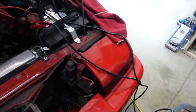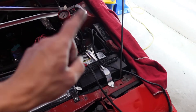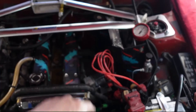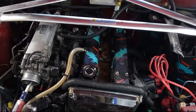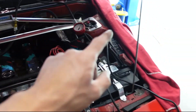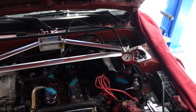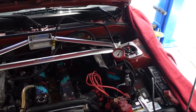Got my battery charger hooked up. You want the battery at full voltage the whole time, because if you have a low voltage battery or a bad starter drawing too much, you're going to get erroneous compression numbers. So pretty much eight cranks, read it, do another eight cranks, see what the numbers look like, and then we'll call it good.